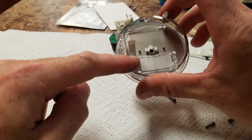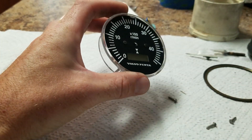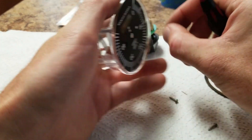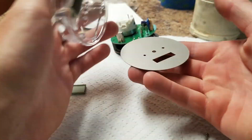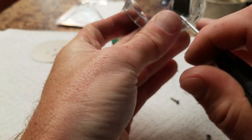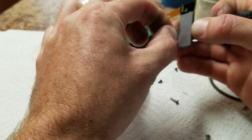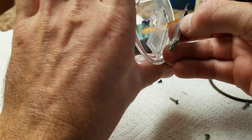In order to get the old LCD screen removed from the display of the TAC cover, we've got these two screws on the front here. Be careful without scratching anything. Let's find an edge without making a huge mess to pry up on that LCD screen. It should have adhesive on it, and I am lucky here — I do have adhesive on the back of mine, so it should be a direct drop in. Don't have to worry about gluing anything.